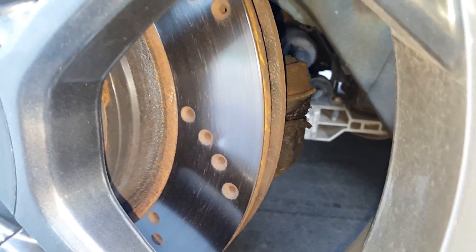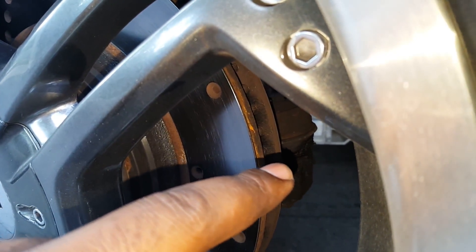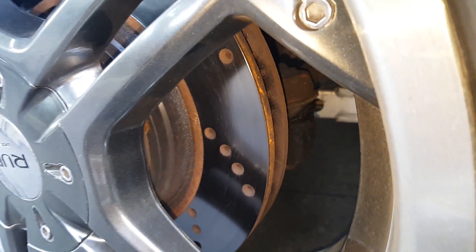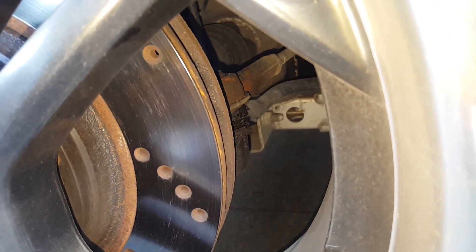As you can see, it's kind of moving — it's going to move this way as we turn, and it's also going to be moving vertically because we're turning the wheels. But as you can see, there's no upward lift on the tie rods, so the tie rods themselves look good.